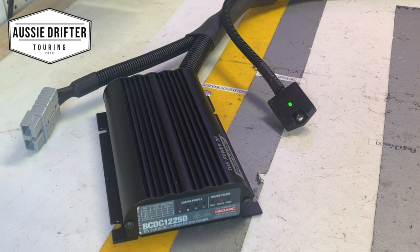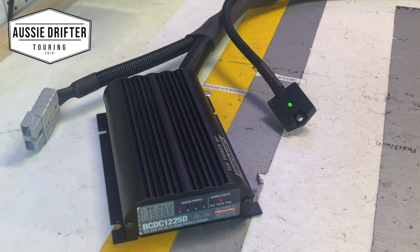I'm going to turn that charger off now — that's kind of like we've stopped the car. It can't see vibration now, and it's going to see the battery voltage slowly going down. Once it's already determined there's no vibration or inertia, and it's seen that the battery voltage has died on the main start battery — which is what the RedArc is connected to — it can determine now that the vehicle is no longer running.